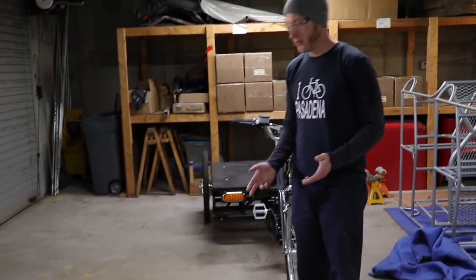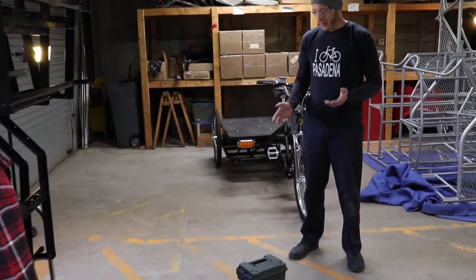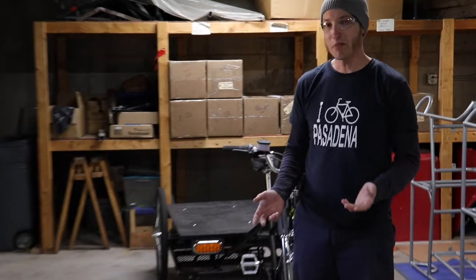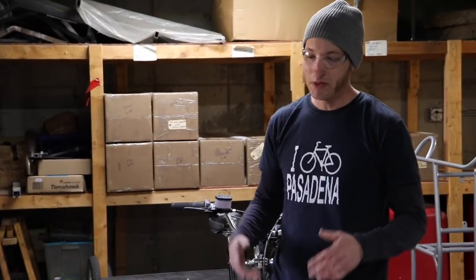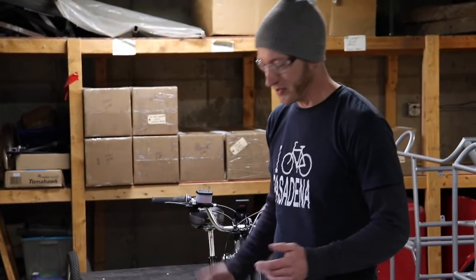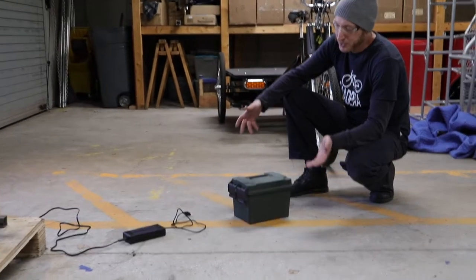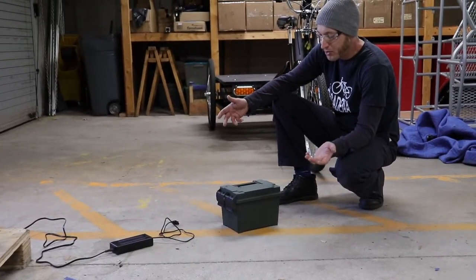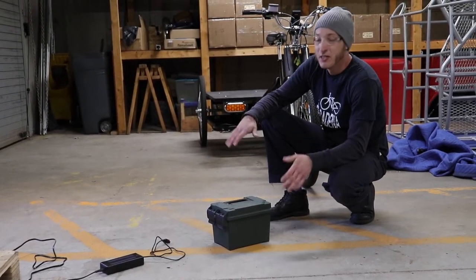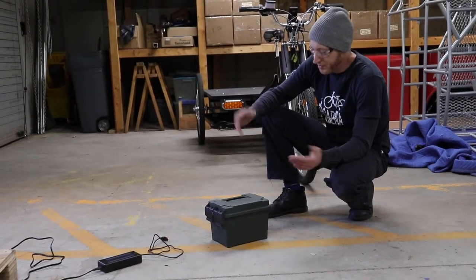So for charging the battery, we recommend charging it outside of the vehicle. It's important to charge it supervised, and you don't have to necessarily watch a battery charge for a few hours. That's not fun. Just that you're in the vicinity of it and awake, if any problems do arise. Put it in a fire safe area. Out on the concrete floor is kind of the minimal of what would be accepted. We recommend a fireproof enclosure, some type of metal box. A small barbecue grill is an excellent and commonly available option.